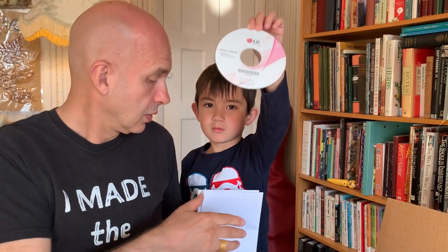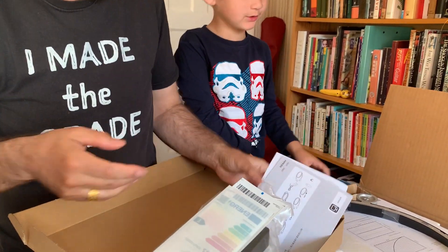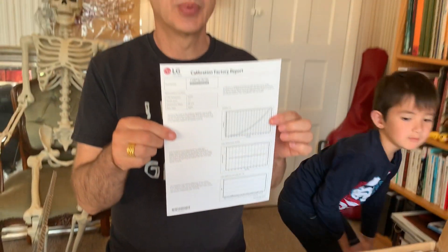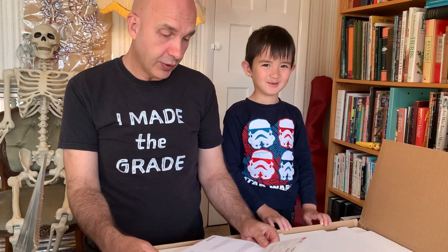That's all the manuals. What Aaron has there is our factory calibration report — we like to see those. It's very, very flat, which is what we'd expect. The reason I'm interested in OLED is that it's fantastically accurate. Being OLED, there are no halos to worry about, no local dimming. Because of the incredibly good black level we're going to get a million-to-one contrast ratio easily. We're expecting 0.0005 blacks, whereas LCD displays are typically around 0.05 — about a hundred times more dynamic range in the black level.